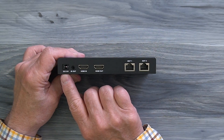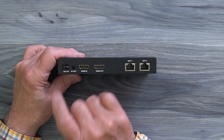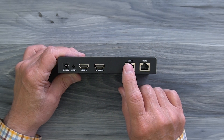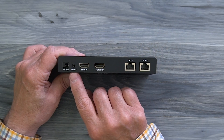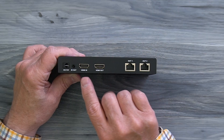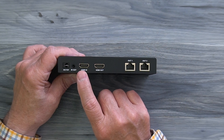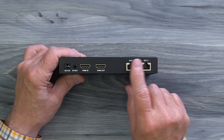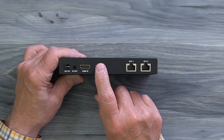On the rear of the sender module, starting on the left, you'll find a DC input port used with the included power supply — simply plug that into any standard wall outlet, and the barrel connection on the other end plugs in right there. Because the solution uses power over cable technology, the power required for the two remote modules is sent over the LAN connections. To the right is a 3.5mm port labeled infrared out, where one of the infrared blasters plugs in. Make sure you check the labels and plug the correct blaster in here. To the right of that are two full-sized HDMI ports labeled HDMI In and HDMI Out. The HDMI In port connects to your media device, and the HDMI Out port allows you to connect a local monitor to take advantage of the local loopback functionality and enjoy the content you're sharing with your remote locations.